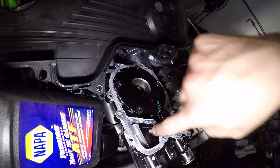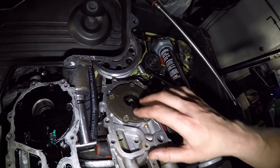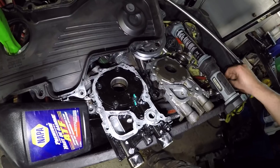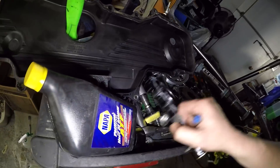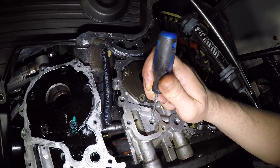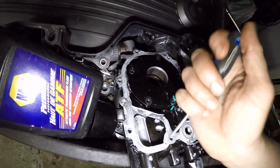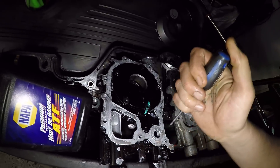The valve is actually this guy right here — looking through that hole, that is the valve. And here is the valve on the pump that came off my other engine, the old engine. It's a nine millimeter. This pump is not actually marked anymore — it looks like they shaved it off when they rebuilt it. I've got the spring out of both pumps, and just like I suspected: here's our good known pump with a moving valve. And here's the new pump from eBay — the valve is jammed and seized in place like someone hammered it in there.